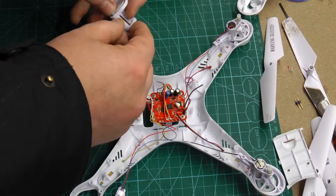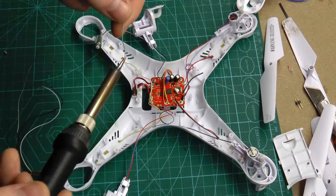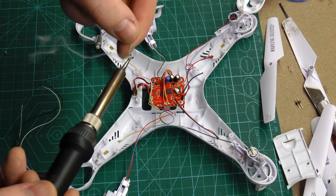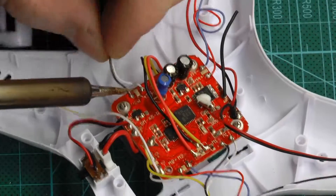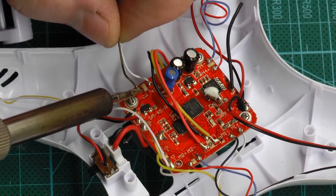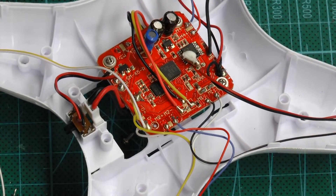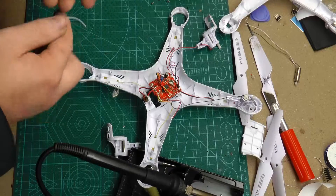After that I pushed out the motor from its compartment. Always make sure that you have a clean tip and put some fresh solder on it — that way you get a better contact with the thing you're trying to solder. I desoldered the two wires from the board. Try not to have your solder iron there for too long as it may damage the board.